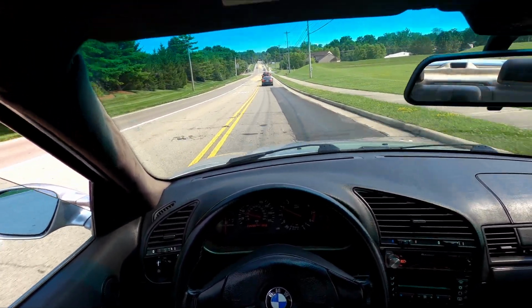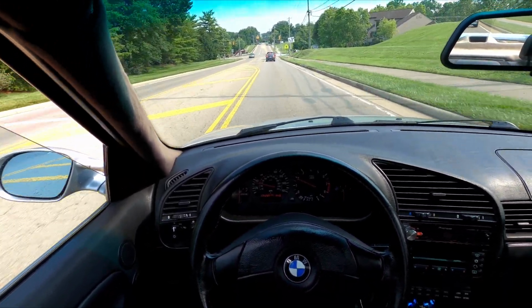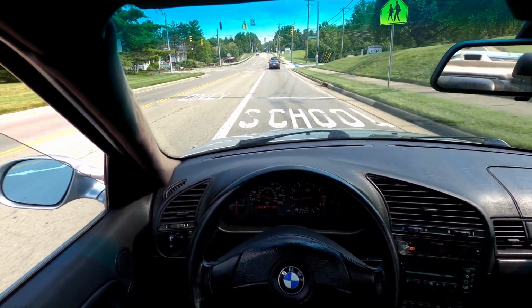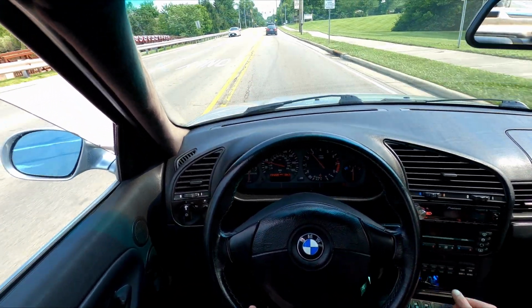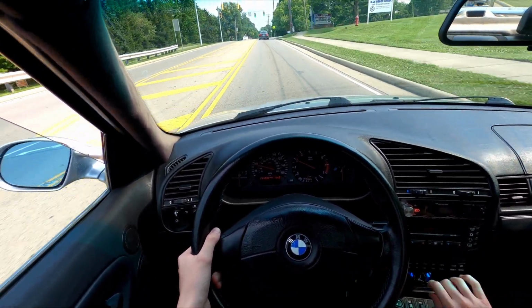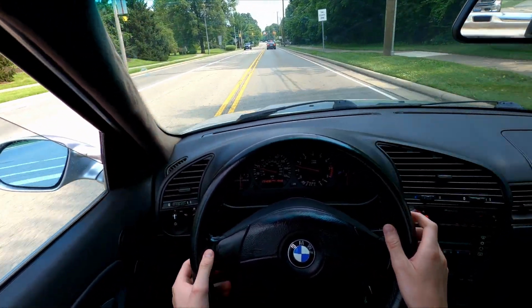It's really bad. I'll show you guys in a second, but if you've got an E36 and you've done new engine and trans mounts, and it does this, that stumble, yeah, you need subframe and diff bushings. It's worse in lower gears too.